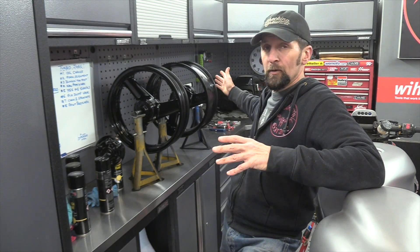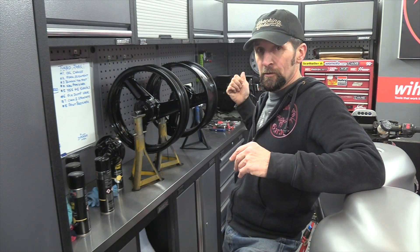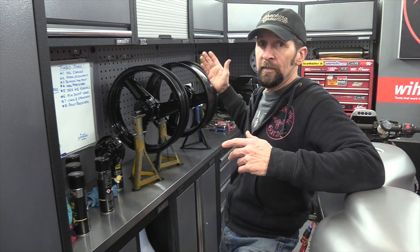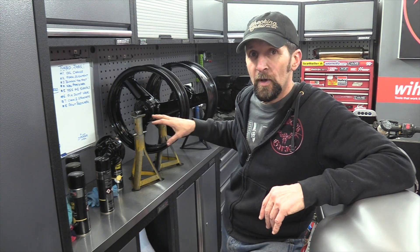In that sense, that'll probably take now at least 48 hours before I want to touch it or put a fingerprint near it. On top of that, the tyre guy said don't bring them back for at least a week - let that paint dry completely before we start muscling tyres on them. So I'm going to double that to two weeks. The front tyre I'm going to reuse because it's a Michelin Pilot Power 2CT - a good tyre, nice sports bike tyre - and its date stamp says June 2015, so it's only two and a half years old, perfectly reusable. The rear was a 180 on a six-inch rim, but I'm going to put the proper original factory 190 section tyre on the rear. I've ordered another Michelin Pilot Power for the rear - that'll be in in about four or five days.